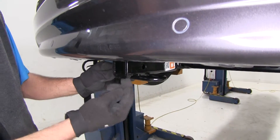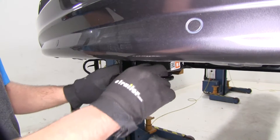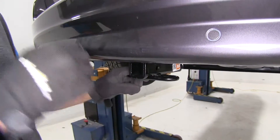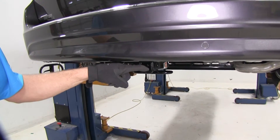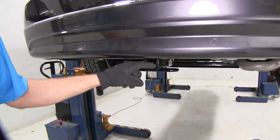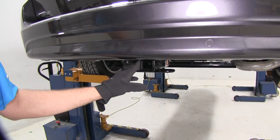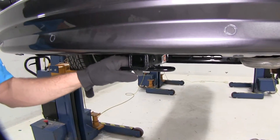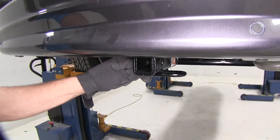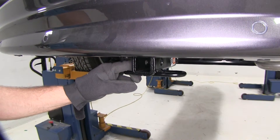Safety chain connection points are going to be a rolled-style steel stock, with plenty of room on each side to make whatever safety chain style connection you might want. This hitch offers a 300-pound tongue weight rating — that's the maximum downward force we can put at the receiver tube opening — and a 3,500-pound gross trailer weight rating, which is the total of our trailer and everything loaded on it. We'll want to look into the owner's manual for the Town & Country to see its tow ratings, and we'll go off whichever of those numbers is lowest.